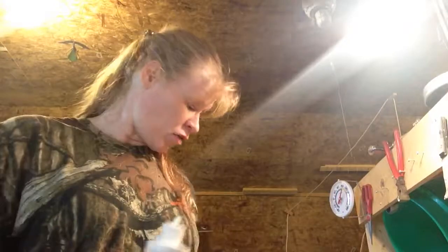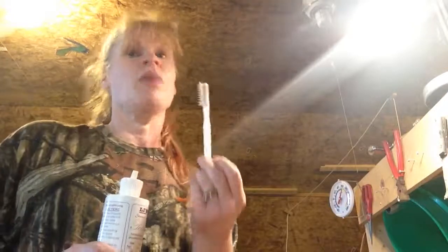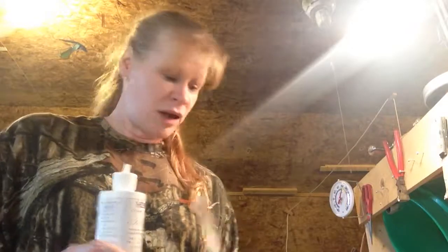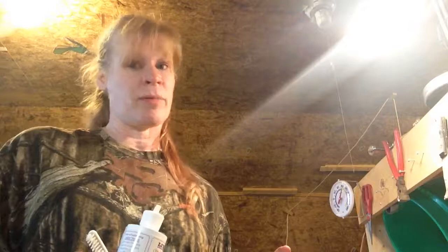You're going to shake it up and squirt it onto the glass — don't worry about the glass, the polish is fine on it. You're going to squirt it on and take a toothbrush and work it in. You don't want to wait any more than five minutes — wait about three to five minutes, and yes, it will still be wet. Then you're going to take a soft rag and buff it very carefully. You don't have to apply much pressure, but if you buff it until it comes nice and shiny, you'll have a great looking panel.